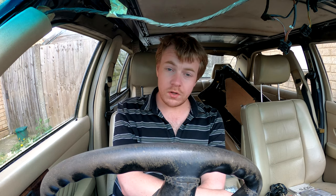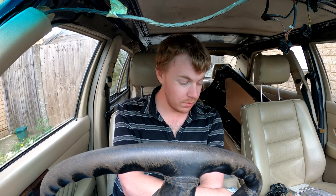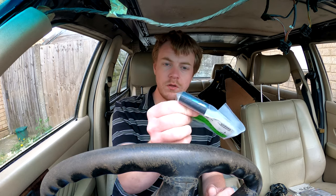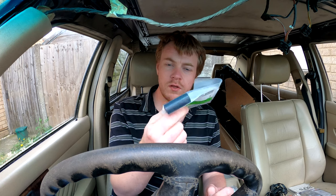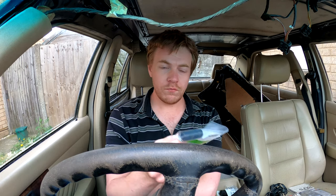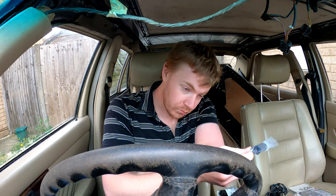When I was looking under the cam cover, I noticed why that's happening. That's when I was trying to figure out why the car wouldn't start. You would have seen that in my earlier video. But yeah, I noticed that little rubber hose was broken. This tiny little hose cost £2.20 from Mercedes. So, it's still available, and probably worth doing, actually, in all fairness. I'd say it's worth taking off your head covers and double checking this, because on cars like mine, it's all degraded and cracked, and obviously it's allowing oil to come through.